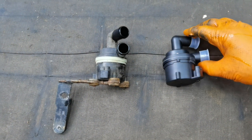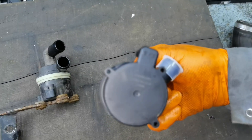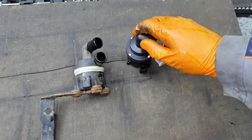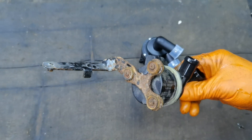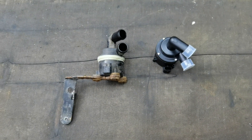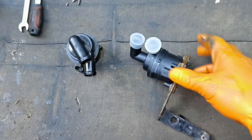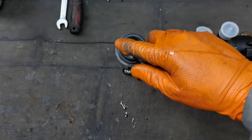Here on the right side I have the brand new auxiliary water pump which I'm going to put on the vehicle — it looks exactly the same as the original. The manufacturer is different as I mentioned at the beginning, and here I have the part code if you want to use it on your vehicle. On the left side I have the original pump I removed, and I'm going to remove the screws securing it to the bracket. If the screws break I'll install brand new screws to secure the new auxiliary water pump to the bracket. I installed the new auxiliary water pump over the bracket with brand new screws because all the old ones broke, and now it's secured and ready to install back on the vehicle.